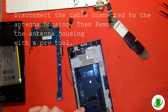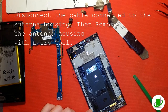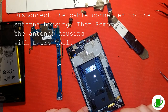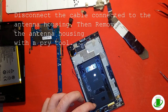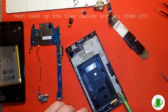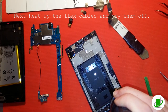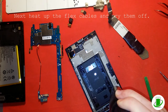Now he's going to remove the bottom part, which is going to be the charging port assembly or the flex buttons, using a pry tool. He's gently prying off the lower left corner to get started. He took off the antenna housing — the antenna piece with the circuit board connected, which was taped on the bottom. Now he's heating up the bottom there to continue working.